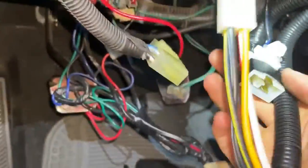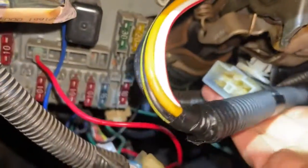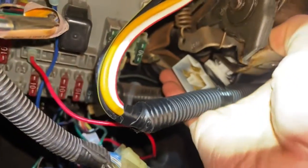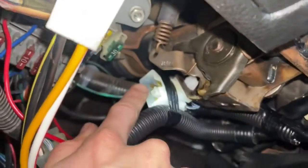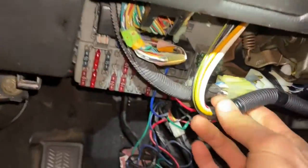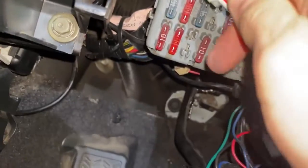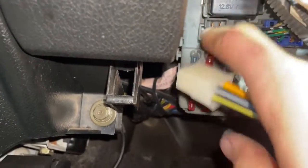This little plastic tab right here is going to go up and into that hole right there. I'll have to do that off camera, but you get the point. This is the five-pin female end, and this is the five-pin male end connector that you'll need to plug in coming from underneath the dash — just push that in until you hear a click. The other thing is this four-pin connector that goes right into the fuse box.